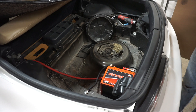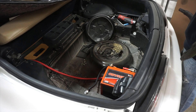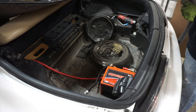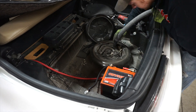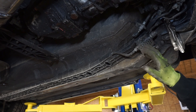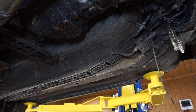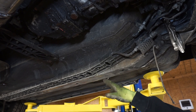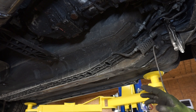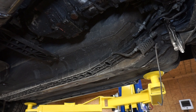There's a rat's nest under here — I'm gonna have to evict these guys. This right here is the stock fuel filter. I have a nice mount to replace this with my new aftermarket fuel filter, so I need to pull down all this plastic cover, get these lines exposed, probably pull this off. I want to take the factory lines out of the car since they're not going to be used. Let's get to it.